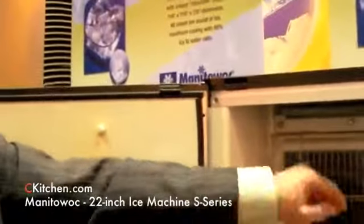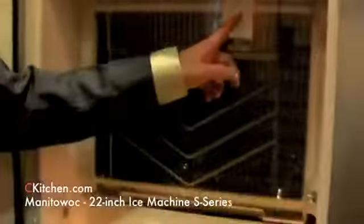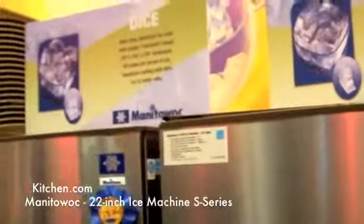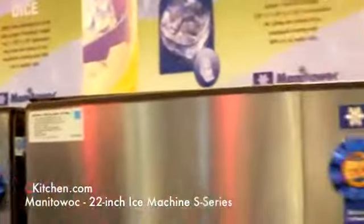With regard to the sachet, when is that required? Sachet is required anytime you see slime buildup within your machine. If you have a tavern where you have a lot of beer bottles that are open, a bakery where they're using a lot of yeast in the air, slime will build up. Slime, you'll notice, will be a white, stringy type of product that's hanging off the bottom of your sump trough or off your water curtain, or you will see a black algae powder that will show up. That's when you need to use the sachets. Okay, and then they can order the sachets.